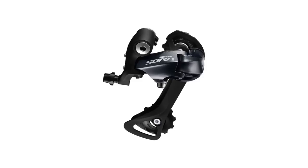You have double and triple chainset options, and the rear derailleur will accommodate an 11-32 tooth cassette along with a 50-34 compact chainset. This is a really good one to look out for on entry-level road bikes as the performance is brilliant and it will serve you well for years. A Sora groupset only costs about £400, so it's an excellent one to pick if you're building up a winter bike.